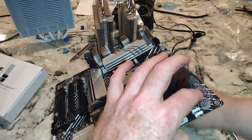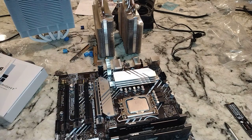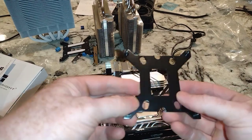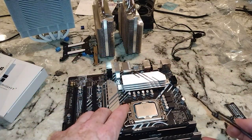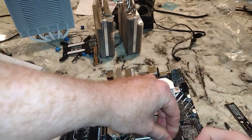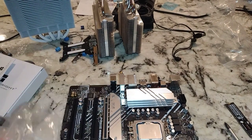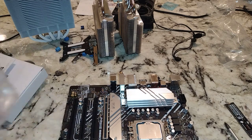So we're just completely taking this out. Just in case I didn't tell you guys, this is an Asus Prime B660 M-A, if I remember correctly. So here is your LGA 1700 mounting plate — there are two ways it can go on. I'll go ahead and show you as I put that in there and drop it down. In the bag there are those spacer-type devices — I'll grab all four of them, and it looks like you screw these in by hand.